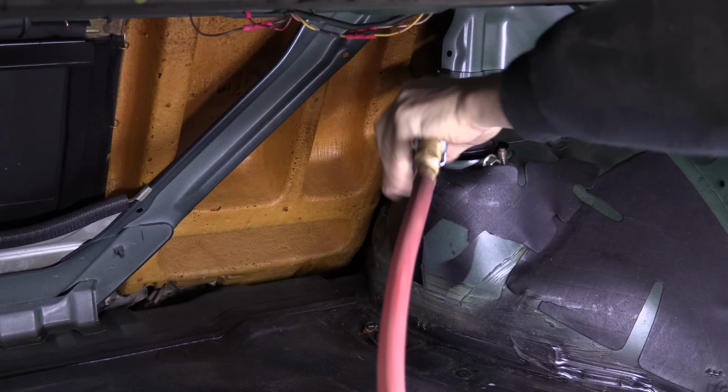Next, I just slowly lower it with the jack, ensuring that the steering linkage lets go correctly, and that I certainly did remove everything I needed to remove from the previous video, which I did. And bingo, it's on the floor. The whole steering, suspension, brake, hub knuckle, sway bar, ABS, and subframe assembly, all out in one piece.